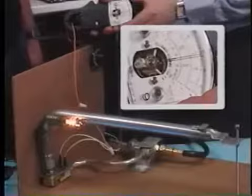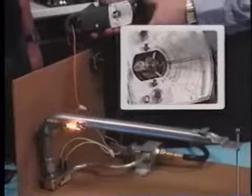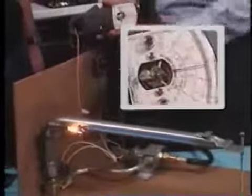Okay. And with a series circuit, you can measure this amperage anywhere as long as you just get one single lead, whether it be on the power cord or down at the valve or just anywhere you can conveniently grab hold of a lead, or wrap around a lead, I should say.